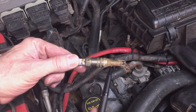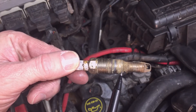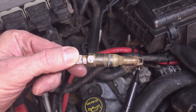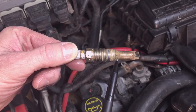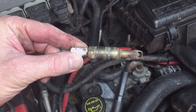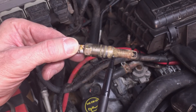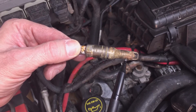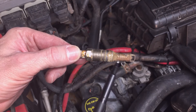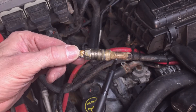This is the issue the Ford Service Bulletin is talking about — this electrode that protrudes down into the cylinder. You can see the spark plug seat and the threads, and this is the sealing surface. This goes down into the head, and it allows carbon to come up here. You can see how this one is rust-colored with carbon that has backed up, become cemented as it corrodes and builds up. Since the original plugs were two-piece, this would separate and the piece would either fall into the cylinder or get stuck in the bore requiring extraction.